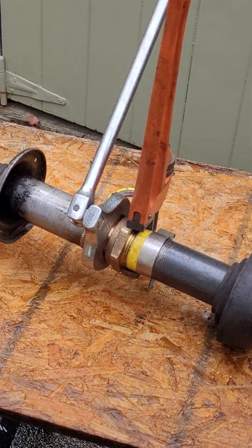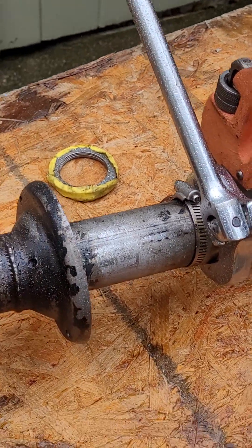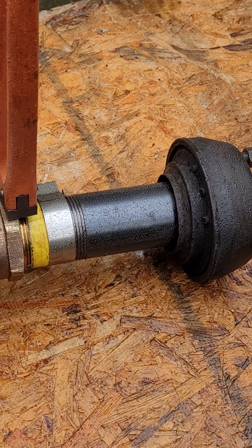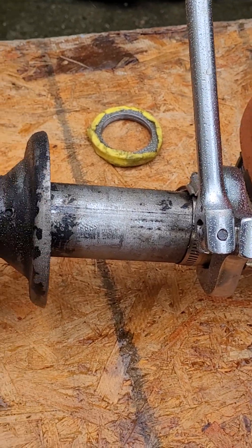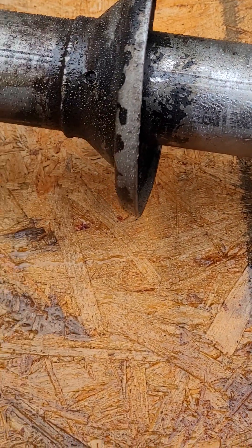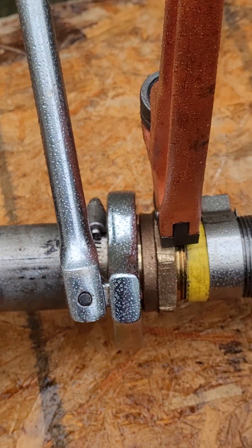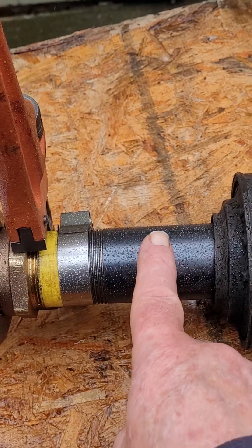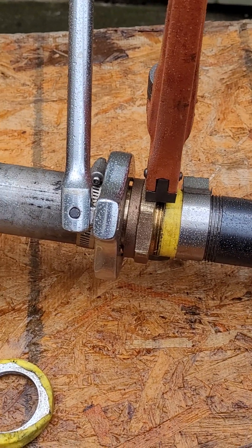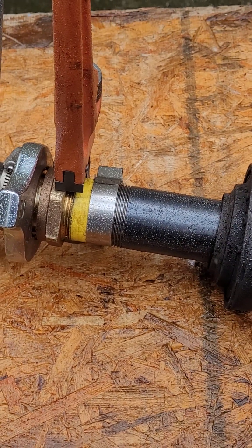There you have the apparatus. This is a two-inch crow's foot wrench and a pipe wrench. This pipe was cut — it was a six-inch, inch-and-a-half diameter nipple; I cut it down to five inches. I use these shims to move it out to accommodate the length as the shock absorber comes out, then I can switch this over to a six inch. Until I get a full inch of shock absorber out of the strut casing, then I can just use the pipe wrench on the shock absorber itself and rotate it out.